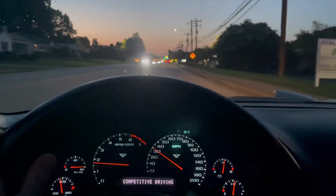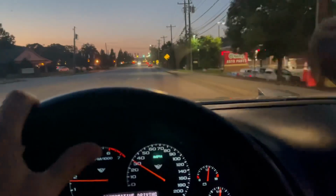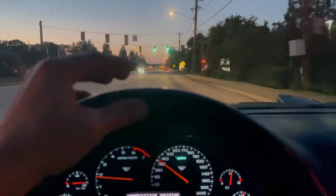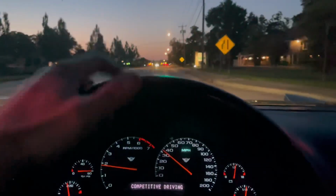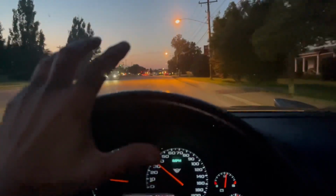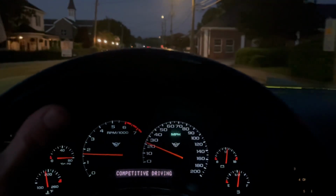Unfortunately, the new wheel bearing and hub did not resolve the shimmying issue that I'm having at highway speeds. However, it most definitely corresponds with speed and not RPM. So, you know, at the highway speeds in 6th gear, the shaft inside the torque tube is spinning much slower than it even is right now, and I don't have any shimmy right now at this speed. So it's, again, leading me to believe that it is wheels being out of balance, which, like I said, very, very possible.